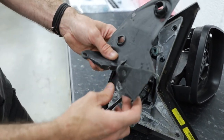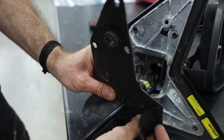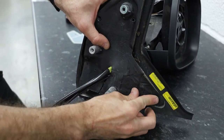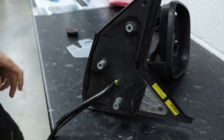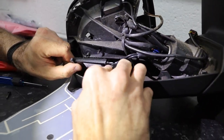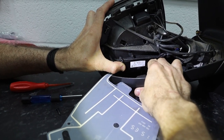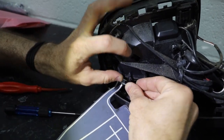Put the water cover or rubber matting back on — that protects the internals and creates a bit of a seal for the wing mirror. You can see it's bent out from factory; don't worry too much, you could heat it with a heat gun. Now slide the antenna booster back into its little sliding latch on the right-hand side, line it up in its carrier, and put the T10 screw back in to fix the booster.